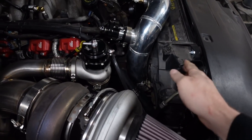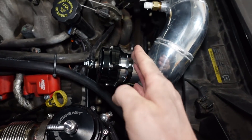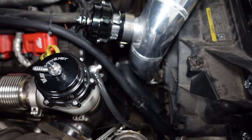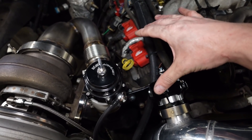If you don't have air conditioning, all you've got to do is plug into pin 33 on the red or green connector and it'll function just like a factory truck. Whenever coolant temperature exceeds the first threshold and then the second — like when towing heavy at slow speed on a hot day — both fans will come on at high speed when that second blue wire gets a ground. As for AC on this truck, when I designed the manifold there was just no way to keep the stock AC pump location, and then the electric cooling fans and charge pipe took up just about all the space between the core support and the engine block, so there's no room for an AC bracket.